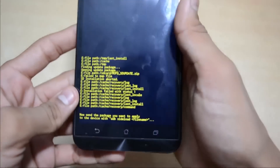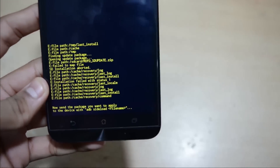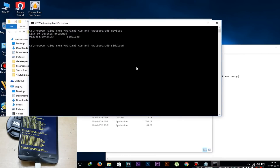Just do the same — install the latest Lollipop version on the Zenfone 2 using the method from that previous video. To install the stock Marshmallow ROM you need to follow the same steps, but first you need to install the Lollipop stock ROM. Watch that video and install the latest Lollipop stock ROM — the version ending in 0.194. Install it clean; you don't actually need to do a factory reset after that, just install the stock Lollipop ROM using that method.